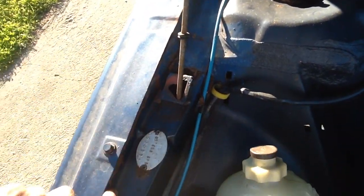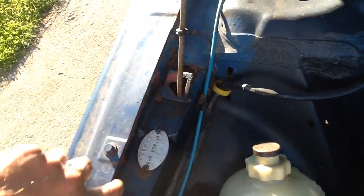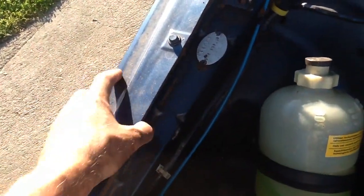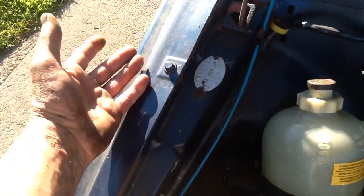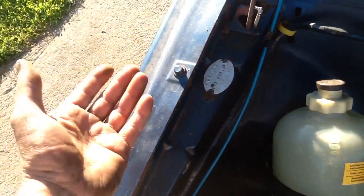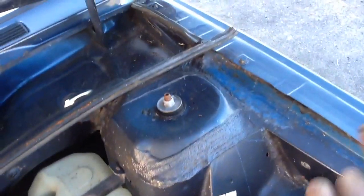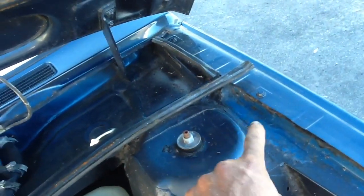Which wouldn't be unusual for a Renault in here, because they are a very common Achilles heel. Most of them all suffer from corrosion, because there is no inner arch or splash arch — it just all comes up and sits in here. There has been a wee bit of repair over in this corner; you can actually see a wee patch. That just needs cleaned off, tidied up, get a look at that.